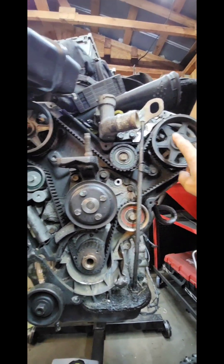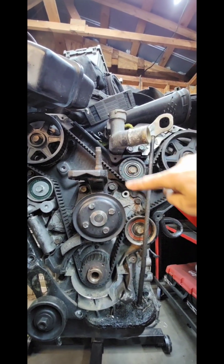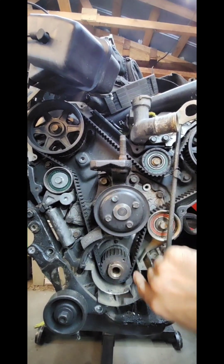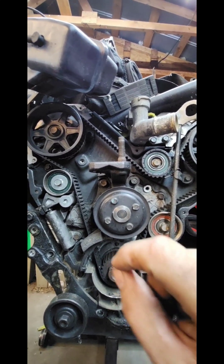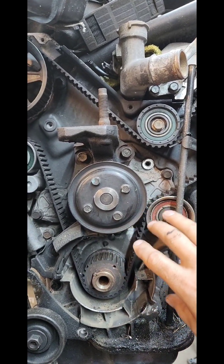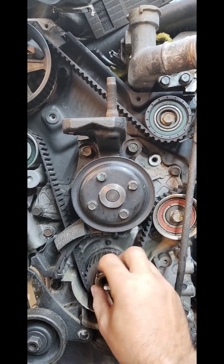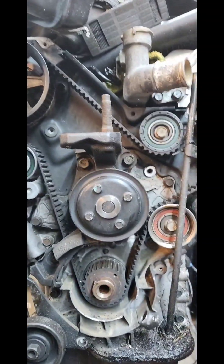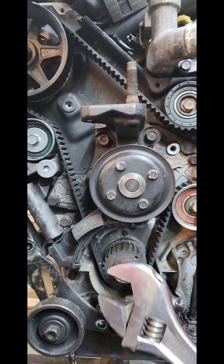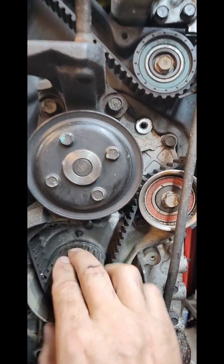Follow me along on this. When you have your front cam set and your rear cam set, and the tensioner has not been installed yet, you want to make sure that the span from here to here to here and all the way around are super tight, and all of your slack is right here on the back side of the rotation. And the only way to do that is by putting this back one tooth. The way they have this engineered, you'll have two teeth's worth of slack back here when everything else is tight. So if you put this back one tooth, it allows you to slide the belt on — get this one on, this one on, and slide the belt on to the bottom. Then you're going to rotate this one tooth to bring it back up to 12 o'clock.